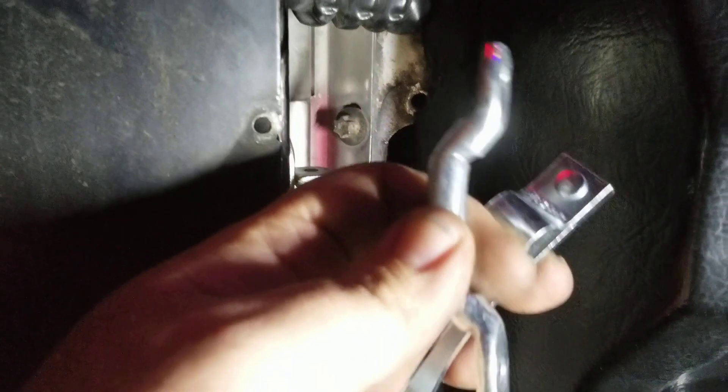So I got to put the two deals here. I've got to slip this through here and then put everything in. So I got the screws in right here. Now this is a little bit tricky — you have to put this little part in first. What I figured out was inside the dash there's a cubby hole in there — you'll find it. There's a hole that you can get into from inside the dash, so you'll have to take your panel off your dash in order to get to that. Then you just tighten down your screws, put your pin in your door, and you're good. Put the rest of the door back together.